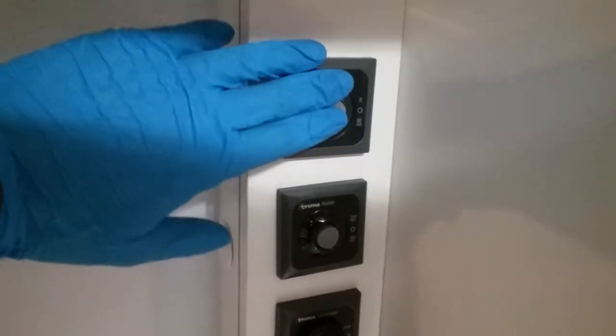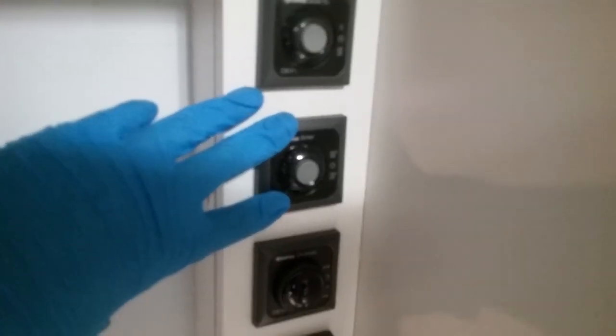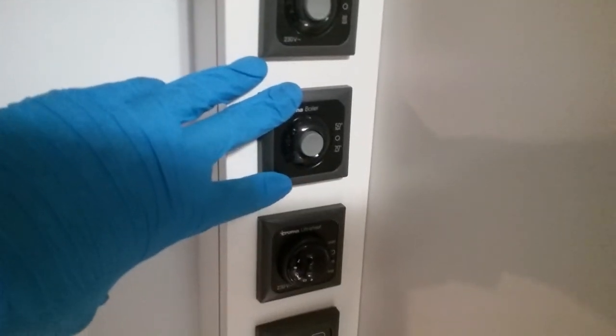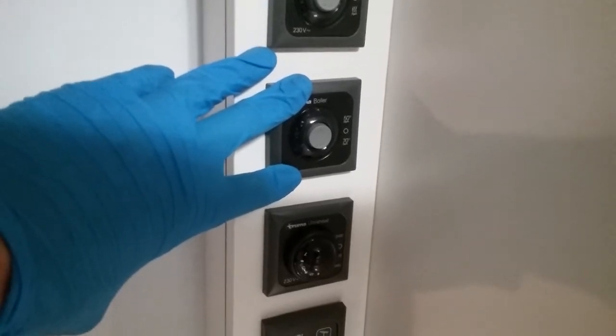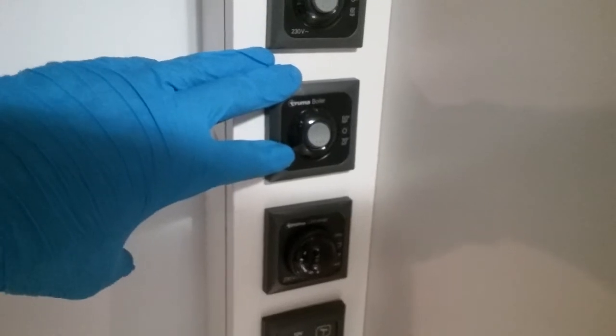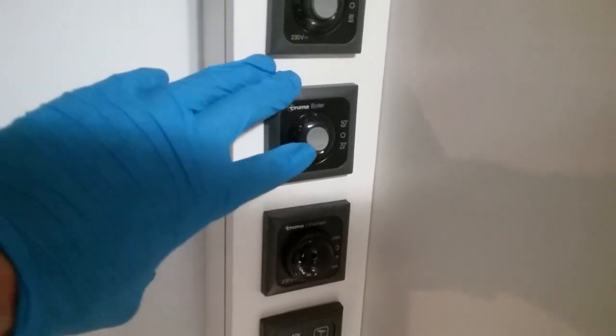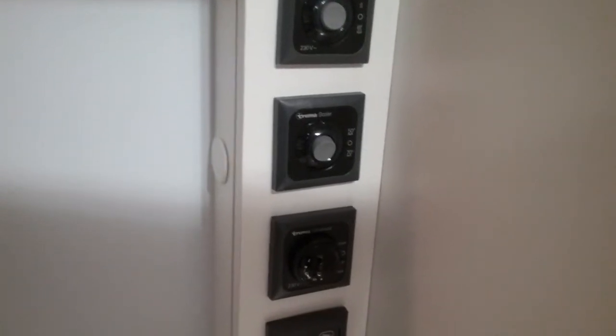If we do not have main supply connected, we can use gas. So before using this, make sure the gas bottle is turned on and that you've removed the flue cover. If we now flick up, again, heat the hot water to about 50 degrees, and if we flick it down, it will heat hot water to about 70 degrees.